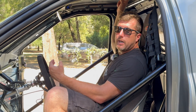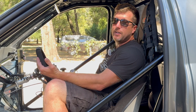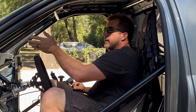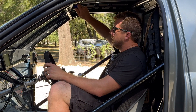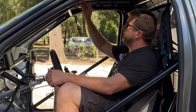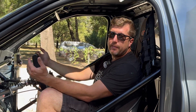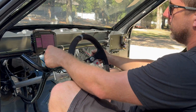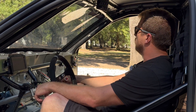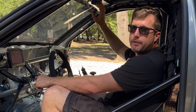Going one stage further on the light switch turns the interior light off but leaves the marker lights on — useful on a well-lit racetrack so photographers can take pictures without headlights blinding them. One more click turns the headlights on for coasting down the top end of the track. One more click brings the interior light back on so you can see what you're doing at a stop. Then you turn the interior lights off when your push car arrives, since interior lights make it harder to see outside. We also have four spare buttons at the bottom, and five unused PMU outputs for future additions — we'd rather have too many buttons than too few.